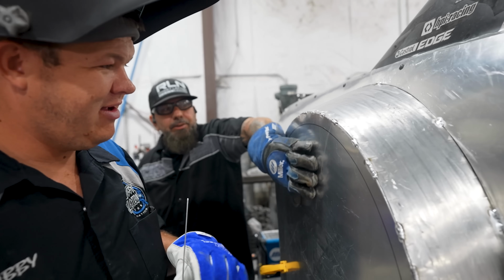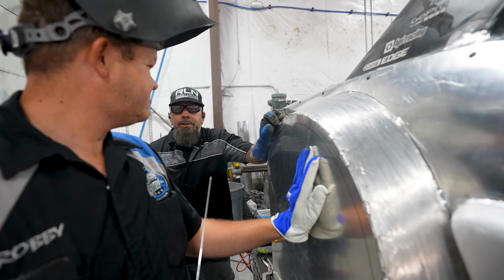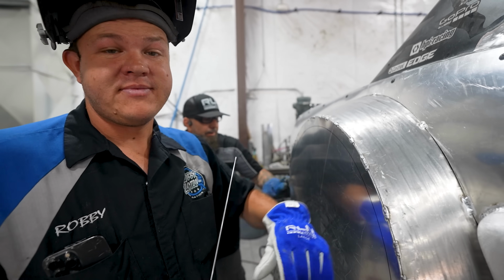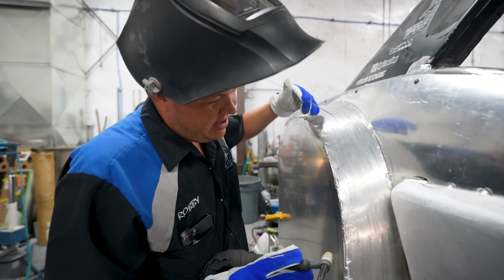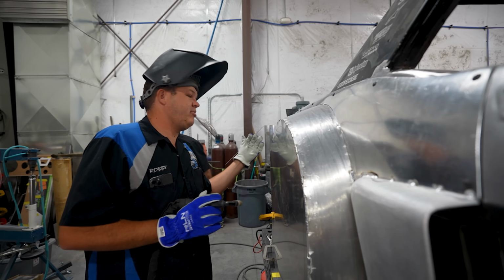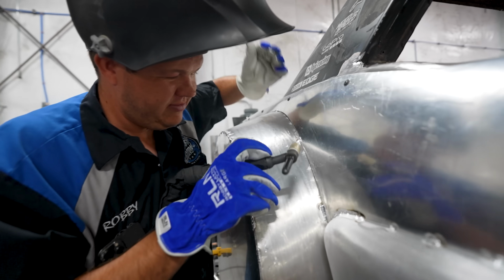If this is dished a little, it's no biggie, because once we cut it, and it's just this lip, we can tap that lip wherever we want it. That's why Sean's the leader of the pack, and we're just the followers. No, you gotta learn it. You're learning. Now we're gonna do like we did on the front and go through, tack every 2 inches. And then I believe it's time to fully weld it. We're making progress. That's good.